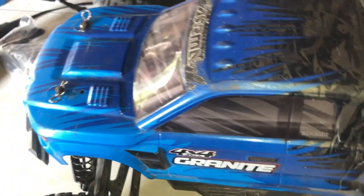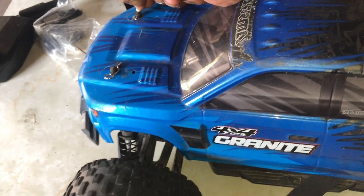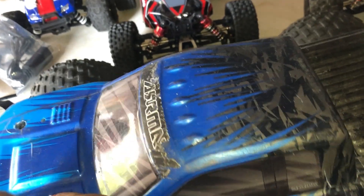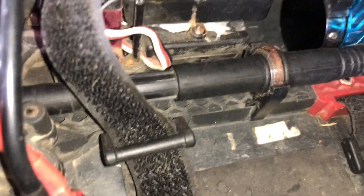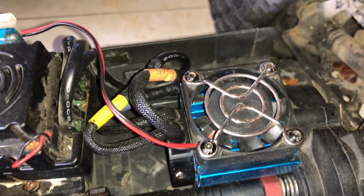So I already brushed this. I had my 3100 or 3300kv motor in here — I can't remember exactly which one. I dropped the body pan — there it is on a tire. It burnt up in this thing so I ended up with it. I gotta clean this all out. I got this HobbyKing cheap 80-amp brushless ESC, and I got the 4300kv brushless motor with a fan that I took out of my KF plane.